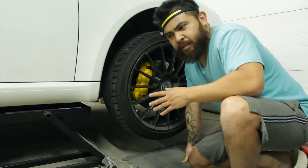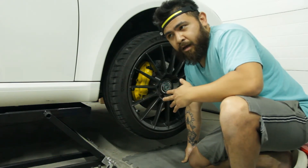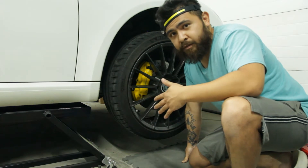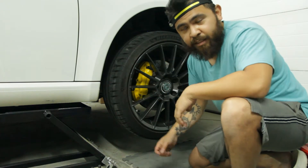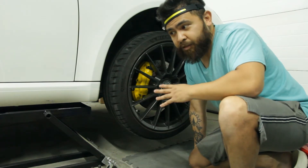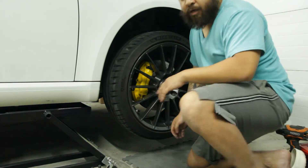Anyway, got back, was doing an oil change and decided to check all my wheels, tires, and suspension because I was hearing a lot of clunks. The car has about 81,000 miles on it, so I'm sure some suspension components are a little tired. I was going around each of the wheels and did the wiggle test at 9 and 3 and 12 and 6, and basically I found that both front wheels have some suspension or steering issues going on.